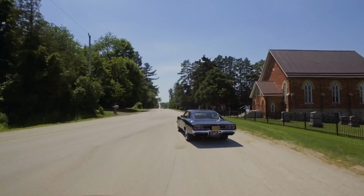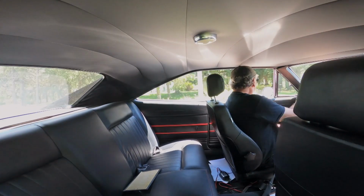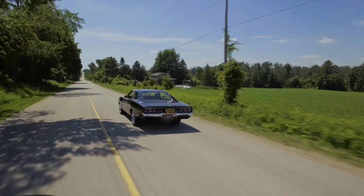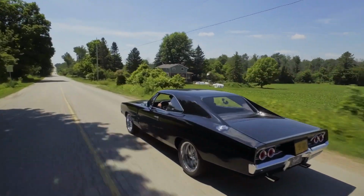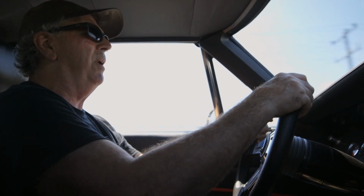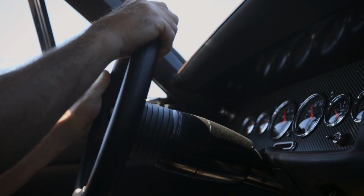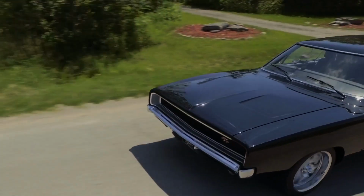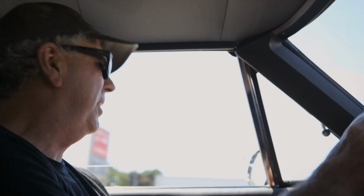It's a brand new car. It's got like 150 kilometers on it. So we want to make sure that the brakes are working and the steering's working and that there's no major rattles. The engine sounds pretty good. I readjusted all the lifters and got rid of that tapping sound. We're steady at 180 degrees. The oil pressure is 75 pounds, so feels pretty good.